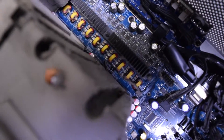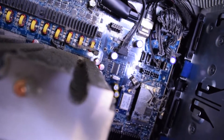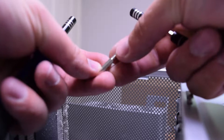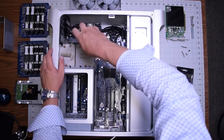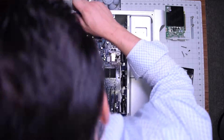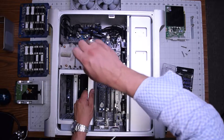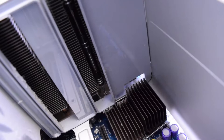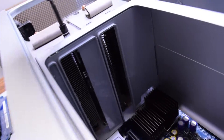With the fan out of the way, let's look at the heat sinks for the CPUs. They're secured by four hex screws each — three millimeter hexes — for eight total. Install the hex bit with the extension and go right down that seam along the heat sink and unscrew it. The screw kind of stays in place; we just loosen it up. Do that to all eight screws.